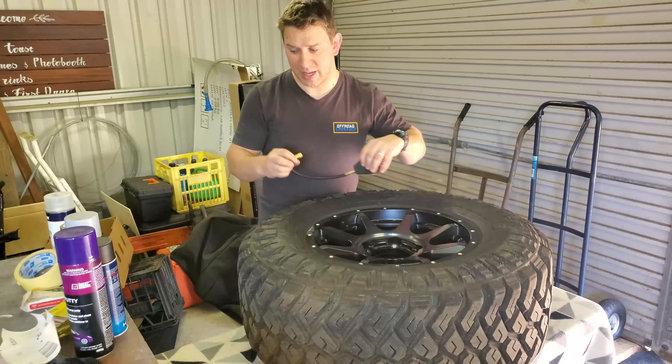Playing cards. We're going to use these to push in between the rim and the tire, basically creating a wall around there. If you skip this step and just paint the rim as-is with masking, you may find a big gap or line where the tire meets the rim — especially noticeable if you're going from a black rim to gold, or a light rim to a dark one. This way allows you to get the paint all the way to the edges.